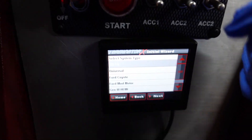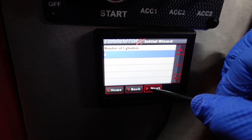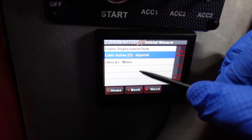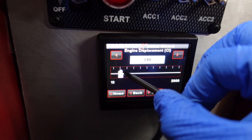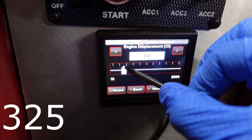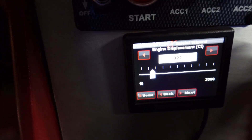Once you do your TPS setup, go GM - that's what we have next. Eight cylinder, yep. Firing order, yep. We'll do cubic inches - I believe this one is a 327, 326, something like that. Then obviously just go through these screens and it'll ask for your fuel injectors. Go ahead and hit Siemens. Unless you have something different, it's pretty self-explanatory. There's loads of videos on this Holley install - just go ahead and check those out.